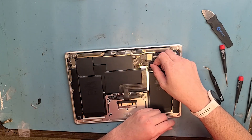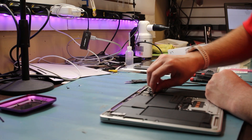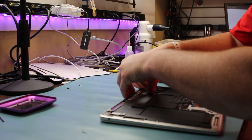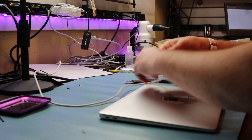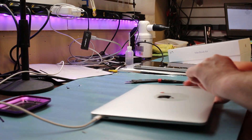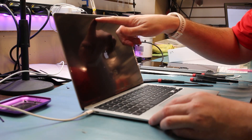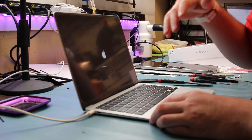Okay, time to test. Let's connect the battery — lay it flat, click in, then lift the little metal bar and flip it down — locked in. Now we're going to test it. Got to plug it in. Normally when you disconnect the battery on a MacBook, it needs to be plugged in after the repair — I don't know why, it's just like that. Let's turn it on — screen is on! We want to test the webcam, make sure Wi-Fi works, and then we're all set. I'm just going to test it and put it back together.